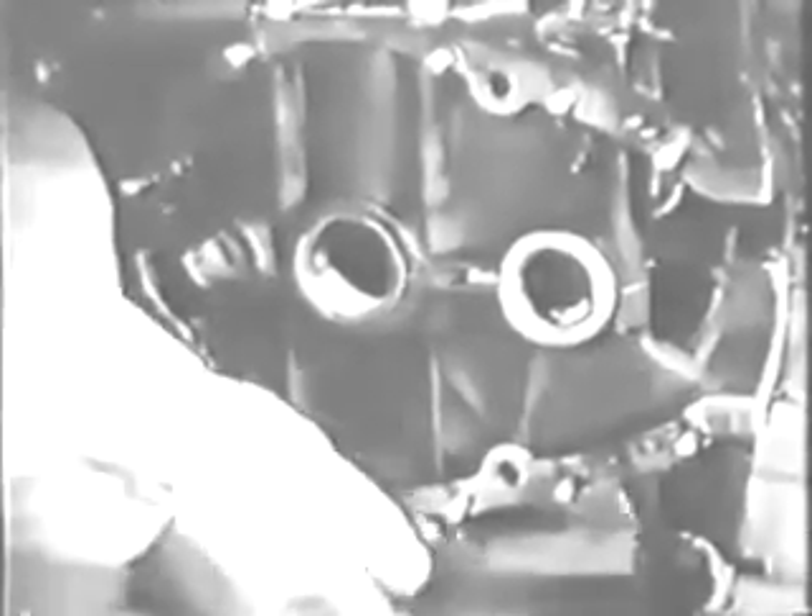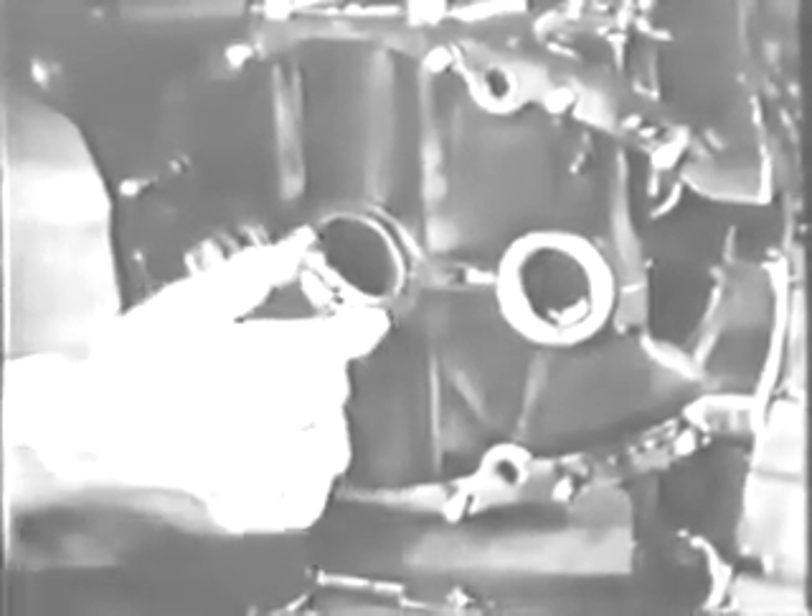Next, take the diameter of the rear main bearing — the one at the other end of the crankcase. Use the telescoping gauge and micrometer in exactly the same way and figure your clearance by looking up on the check sheet the diameter of the crankshaft at this point. You'll have to reach down through a cylinder port to get at the center main bearing to measure it. Otherwise, the procedure is exactly the same.